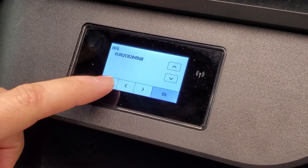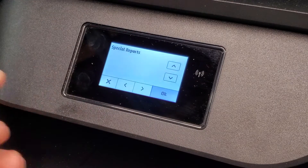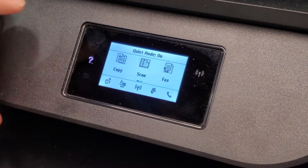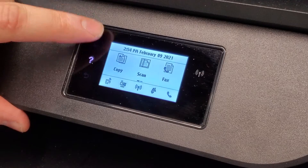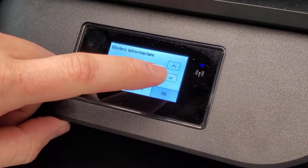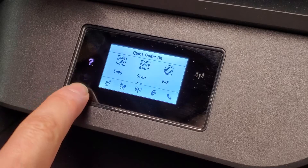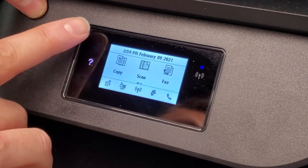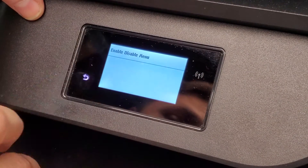There's also a manufacturing menu in there. If you need to get into the service menu, which is the support menu, that's something there too. There's also this menu: you just press home and back button back and forth, and it's called the enable/disable menu. That's for special reports, wireless infrastructure, and other settings. This works on these printers — for example, the 6958 and similar — and honestly, a lot of the HP OfficeJet and Envy printers from 2018 and up. So: home, back, home, back, and you're there.